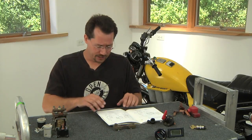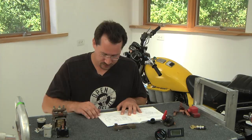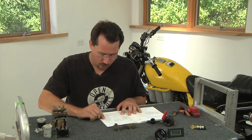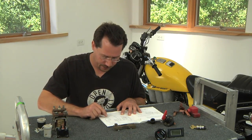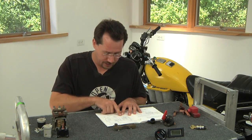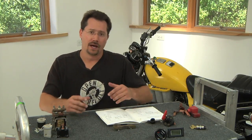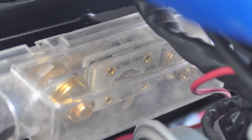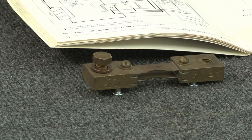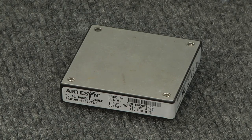Most of those parts you can actually see right in the wiring diagram. Looking down here, I'm going to see a power wiring fuse, a main contactor, a pre-charge resistor for the main contactor, an on-off switch for the system, and a couple other small components. Some of these components include the main fuse, the ammeter and shunt, battery shutoff, the main contactor with the pre-charge resistor, the key switch, and a DC to DC converter. We'll go through and cover each of these in detail.